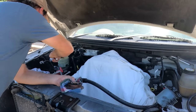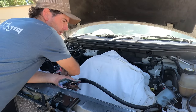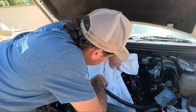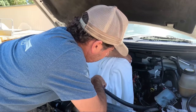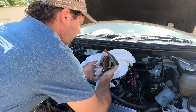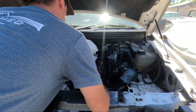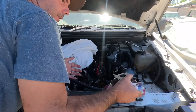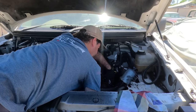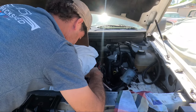And so while this cam gear is still incredibly warm, wrong side, this side, Michael. I'm just gonna fit him on because if it's heated up, it's expanded, and I can tell you, it's still pretty warm. So warm, in fact. Damn, Jesus. Let me get some gloves. And we'll have to torque them down. They torque to yield as well.